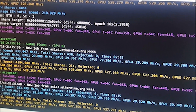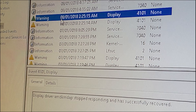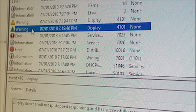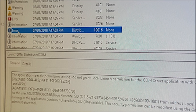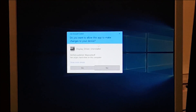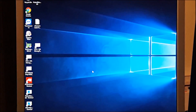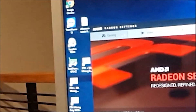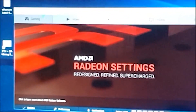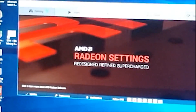Now I'm not gonna lie — I almost went crazy running this rig because it would crash after a couple of hours running. I lessened the overclocking a bit, even brought it back to stock settings. Tried 4 different graphic drivers: Crimson 10.4, Crimson 11.4, and the new Adrenaline driver. It was a wreck. Those drivers were producing only 19 megahashes per second and you have to switch to compute settings to get better hash rates. Problem was the settings wouldn't save for all of the video cards.